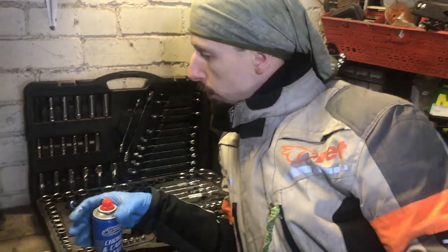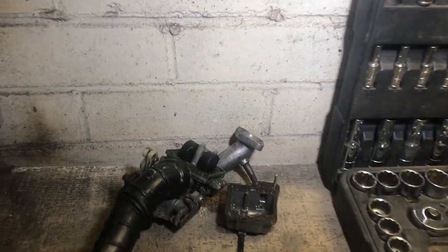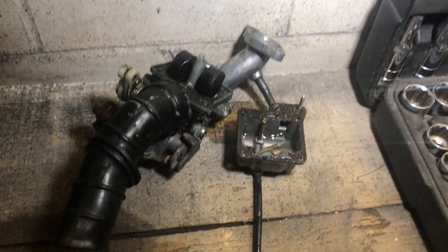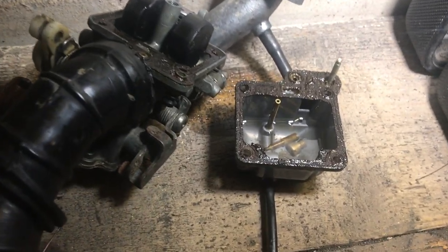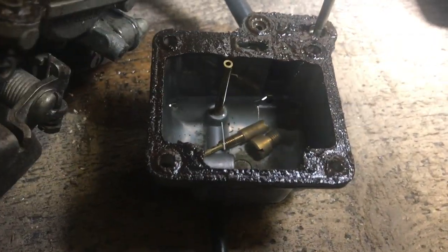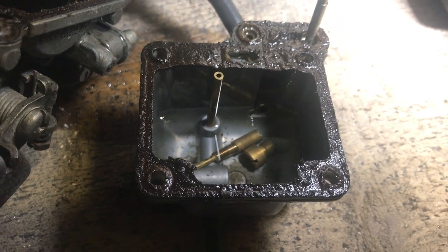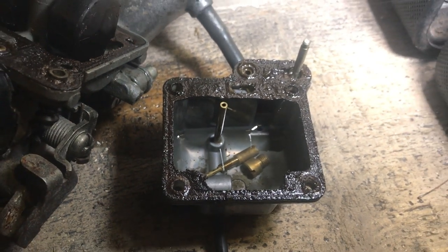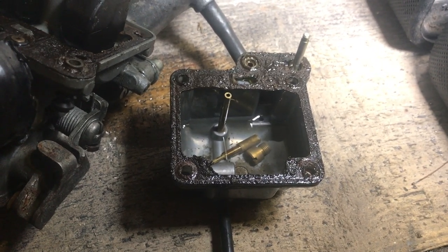What have we just done, Kieran? Well, anything that can hold fluid we've filled with carb cleaner. We'll let them sit and stew for a while to do its business — should get things functional. We've taken out the main jet and the pilot jet and sat them in a bath of carburettor cleaner. That's probably just going to evaporate off over time, but hopefully it will do some good before it disappears.